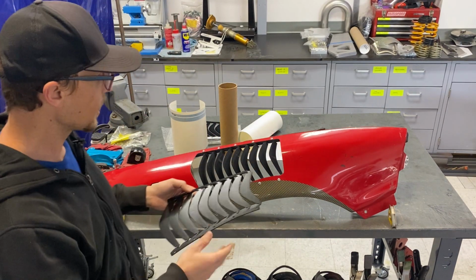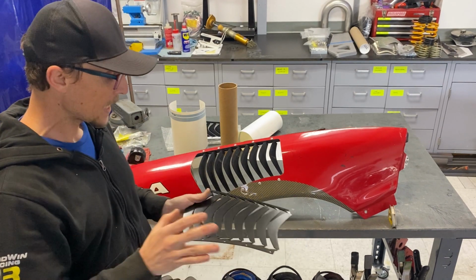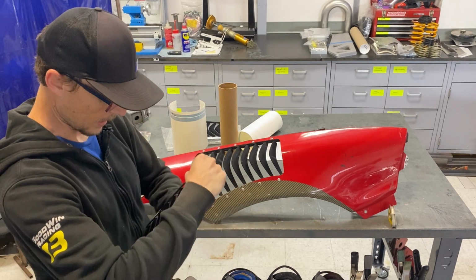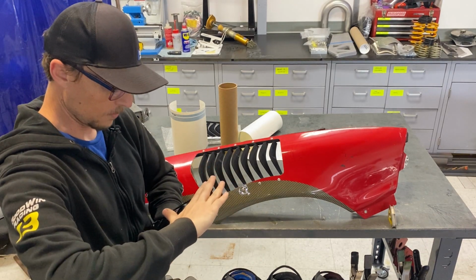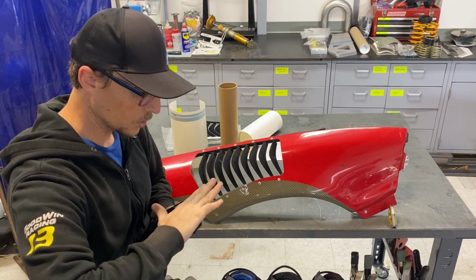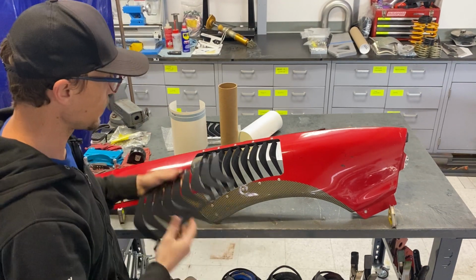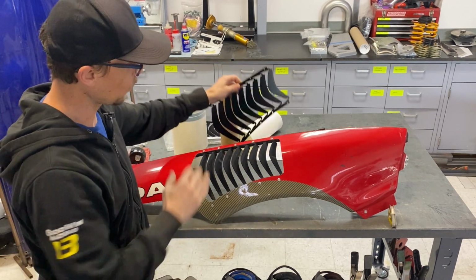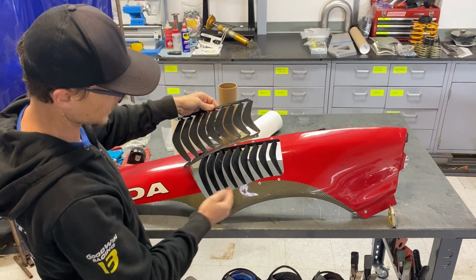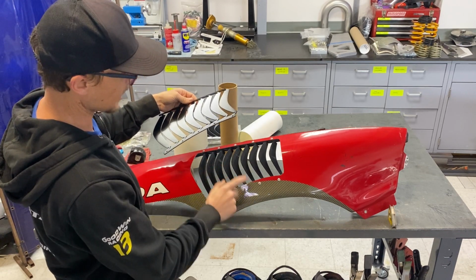So once I've got the flange angles right or close, the last thing that I'm going to do is take the whole thing, and sometimes I'll put one edge against my stomach and a hand in the middle and a hand on the top, and try to give it a little bit of curvature this way, just a little bit, because you'll see that when you set it in, while it's straight, it's going to contact at the corners and still be a little low, a little off of the backside of the fender in the middle.